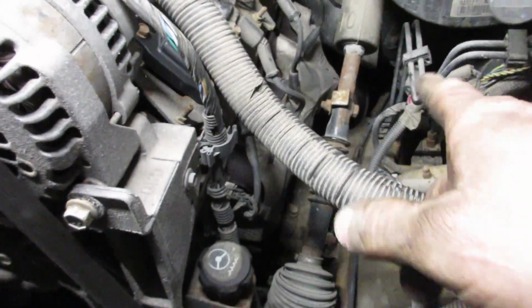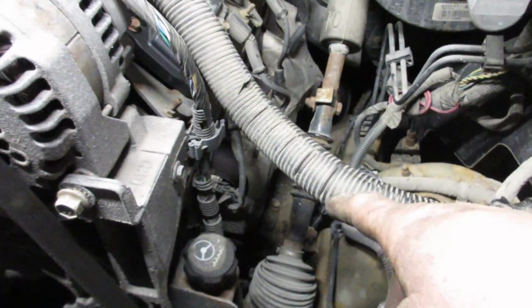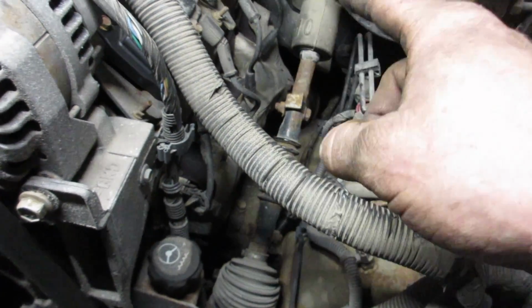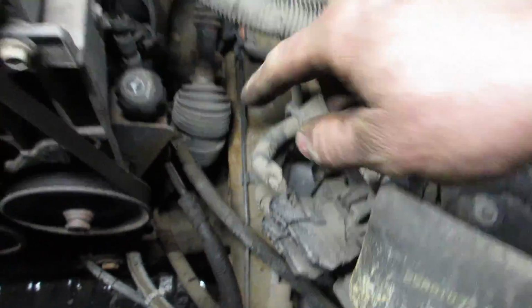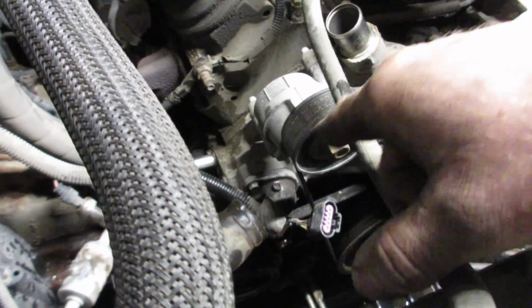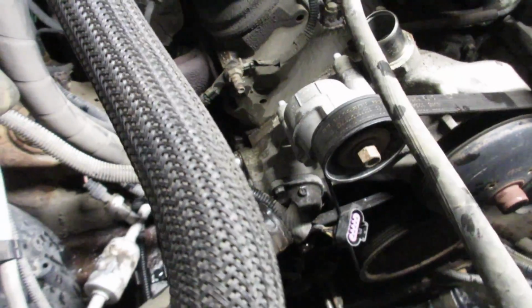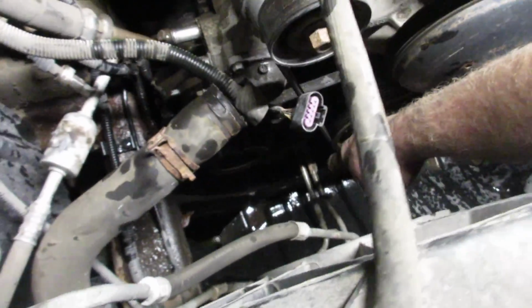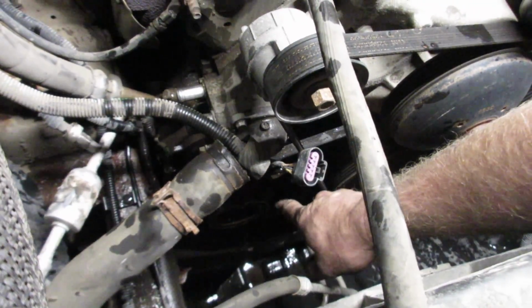Take your exhaust off. I'm gonna take the exhaust manifolds off anyway. Those will probably be the hardest work. Your torque converter bolts at the back, and your fuel lines and your power steering lines. Your air conditioning, just leave the compressor where it is so you don't have to drain the system. And that is about it. The transmission lines are attached to the oil pan, so make sure that they're disconnected.